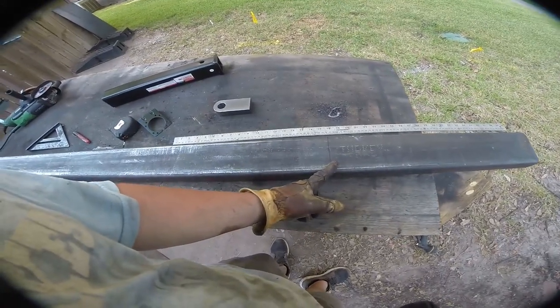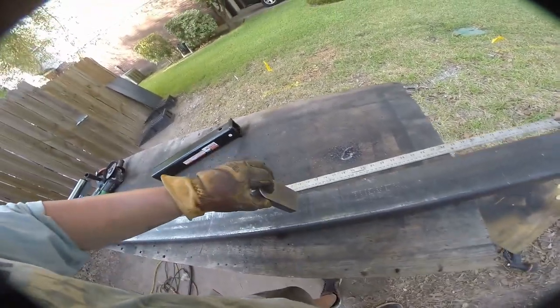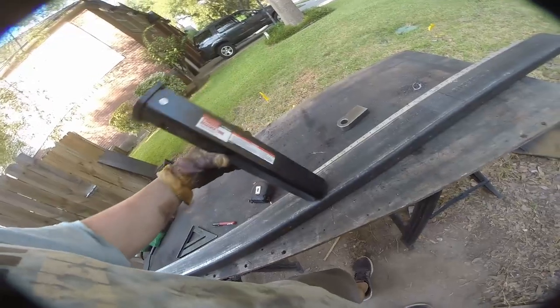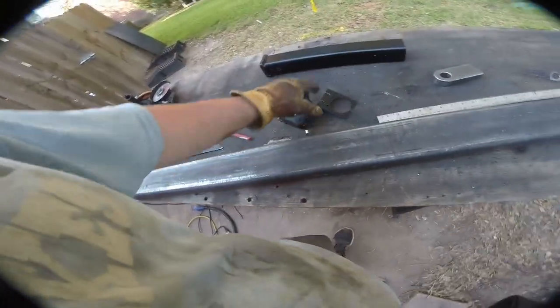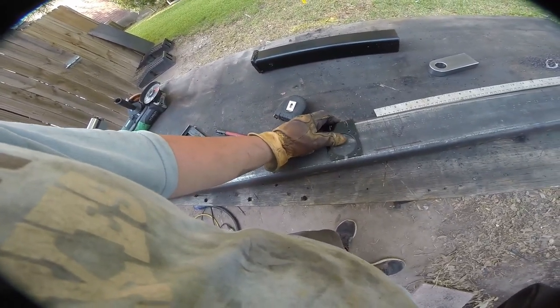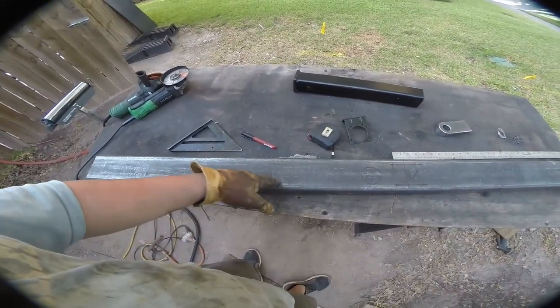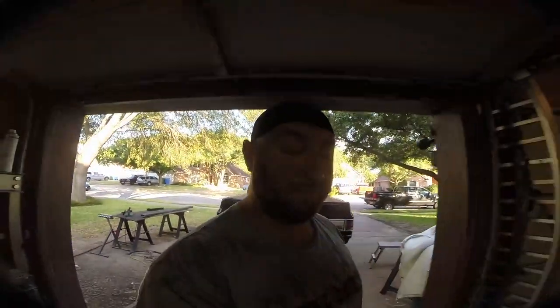These frame mounts are wider — I think like 34 inches wide compared to like 26 on the front — so we're gonna move these inboard; this is where our shackle points are gonna go. In the middle we're gonna put a standard receiver tube, cut it down to eight or nine inches — basically four inches in front and two inches in the rear so we can gusset it. This is our wiring for the trailer and potentially a brake controller. We're gonna weld chain loops under here for trailer chains. I'm gonna get the plasma cutter and start cutting these out — if you don't have a plasma cutter you can use a cutoff wheel and drill out the corners. My little $200 plasma torch is by far my favorite tool for this kind of work.